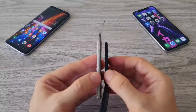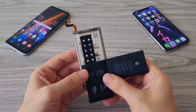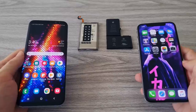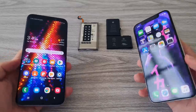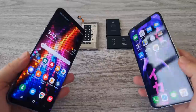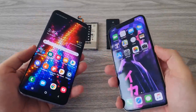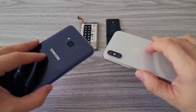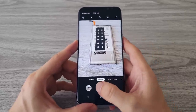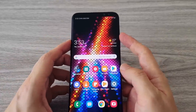When it comes to differences between replacing the battery on the Galaxy S8 Plus and the iPhone X, the replacement on the iPhone is easier. Samsung really loves glue and uses it a lot. The water-resistant adhesive stickers on the Galaxy S8 Plus also use much more glue, though this is understandable given the different back panel design. Regarding comments on my iPhone X battery upgrade video — some say 300 mAh is a very small upgrade, but this is not true; it gives more than an hour of extra battery life. iPhones don't have bigger batteries because they are very well optimized — not only iOS but also the hardware — and tests show iPhones have better battery life than many Android phones with much bigger batteries.